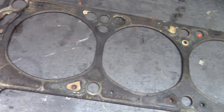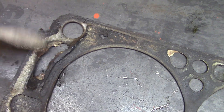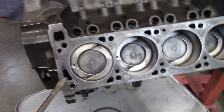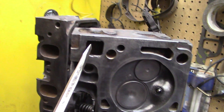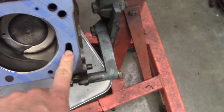Here's the old gasket, and I noticed there was an opening here. At first I thought this gasket is missing that, but then looking at the other one, it's not there. A closer look and it looks like it actually eats through. So that's kind of curious. I started studying the block, and it looks like the water pump pushes in the coolant right here. It goes through all these water jackets around the cylinders, then comes up through all these holes here, up through the head. And it ultimately exits here into this hole, into your thermostat housing area. This here would be returned from the heater core.